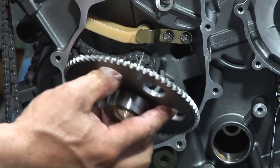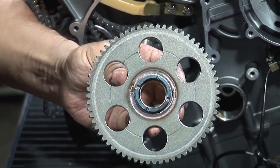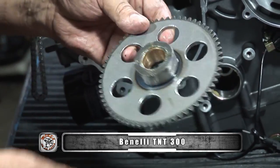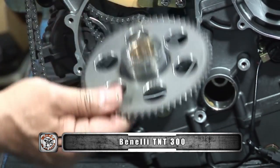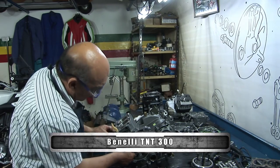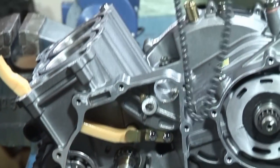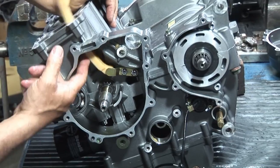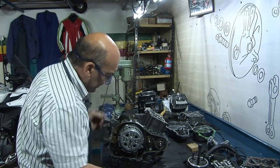Now we come to the Bendix gear, which is mounted on a bushing with lubrication — what we call here in Argentina 'pata de araña' (spider leg): oil inlet and outlet so it never seizes, since it operates alternately every time we press the starter motor. And here by hand you can remove the distribution chain — it's a Morse chain — and from this side there's nothing more because there's the crankshaft gear with the distribution gear and the tensioner, which is removed with two bolts.